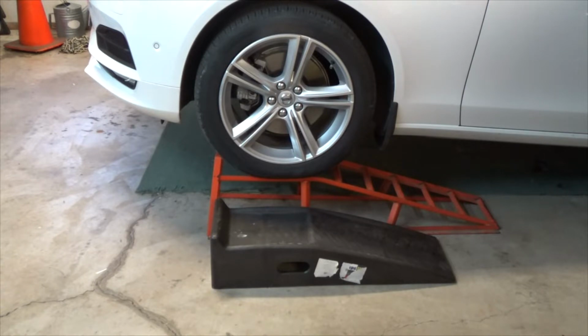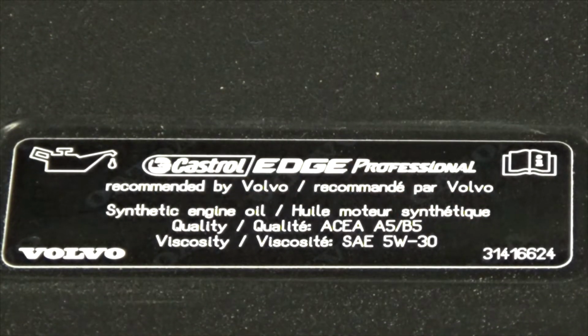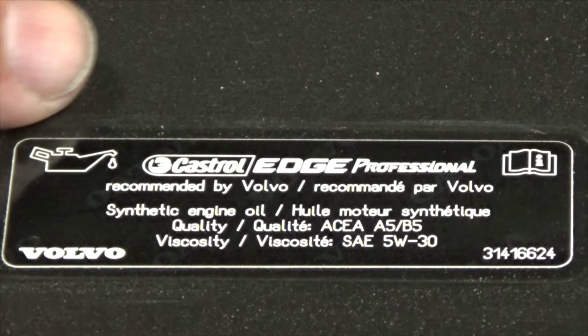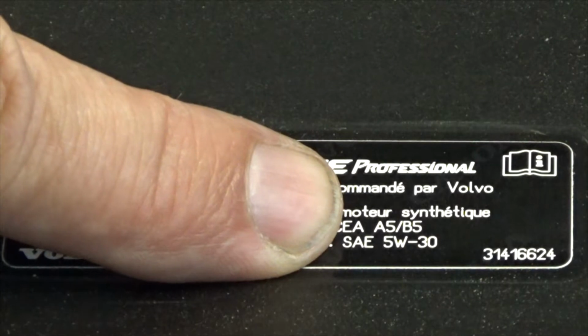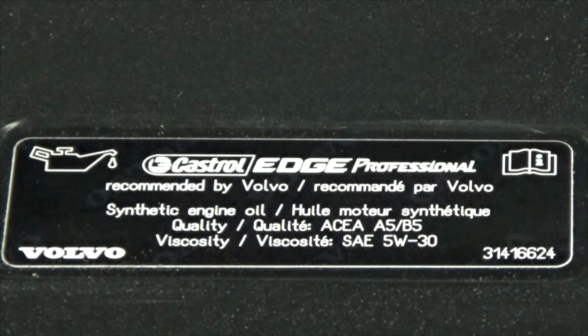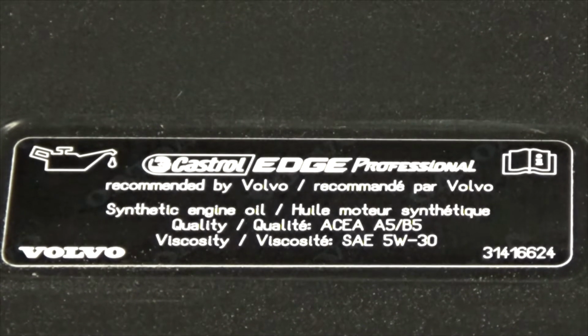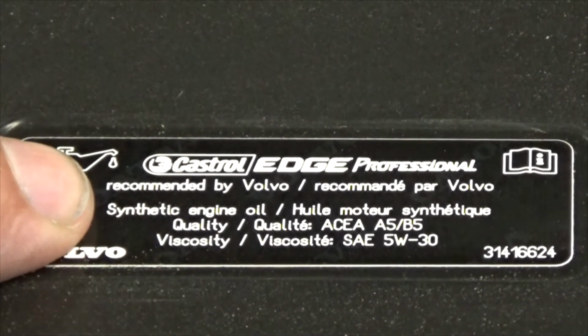So you definitely have to lift this vehicle up to do an oil change. No doubt about that. To get it up on the ramps, I ran the engine, got it a little bit warm, got it circulating a little bit. Also, Volvo recommends Castrol Edge Professional, and it also recommends SAE 5W30. I use synthetic 5W30, so I don't use that particular brand. But anyway, just saying what Volvo recommends. And it says recommends, not you have to use it.